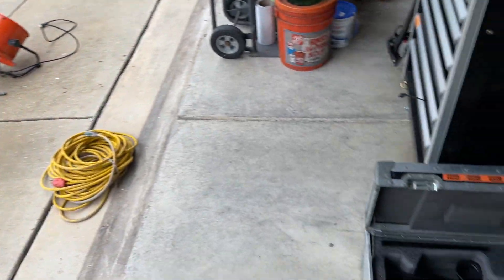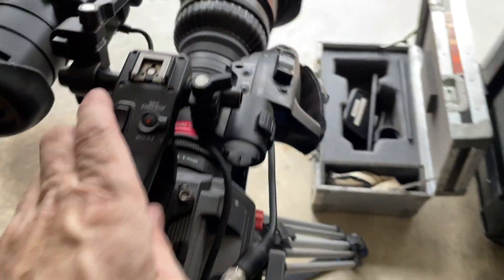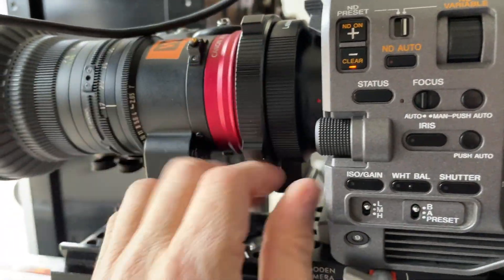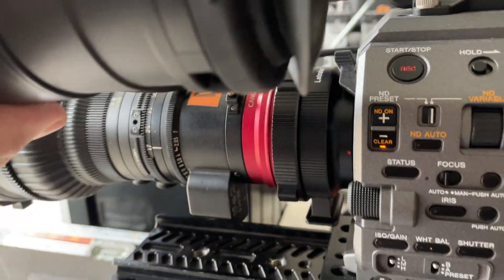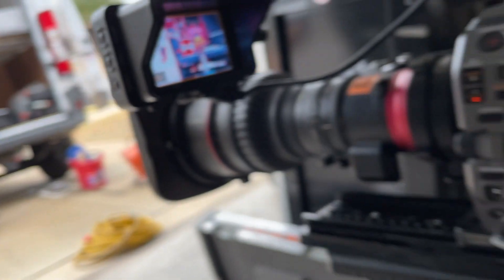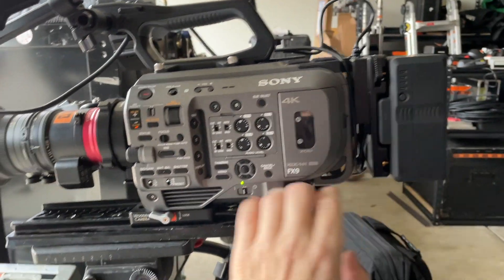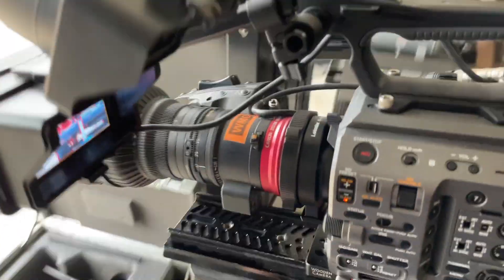I just did a back focus check on this zoom. It's held perfect on all the cameras I've mounted it on over the years — I've never actually messed with the back focus on this lens. But in this case it is out, and I suspect the source of my problem is this Sony E-mount to PL adapter I purchased on Amazon. After a minor back focus adjustment it's holding great — I'm in magnify mode here at 3x. I'm not going to run rods; it feels solid. The weight's a little forward, so I may run dual battery mode if I'm doing a bunch of shoulder work — it'll balance better.